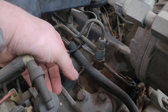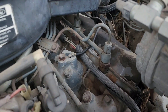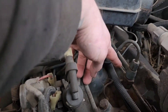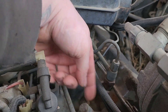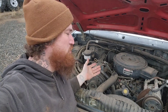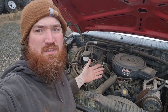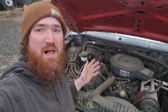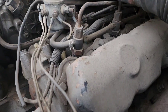My first tip: if you've got those old gray return line caps, keep them. Unless your nipple is broken off or you've got a crack in it, those are probably the best caps you can get. In my experience, those gray caps are OEM factory caps or factory replacement caps. Either way, they are the thickest, best plastic, best fitting caps you're ever gonna find.